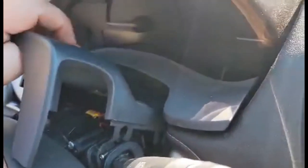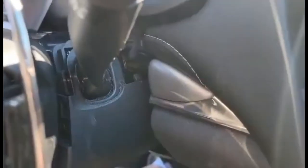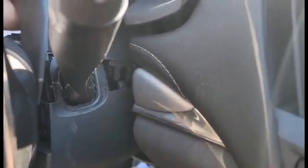To get to those bottom two bolts, you've got to take this off. There will be fabric back here that's in the way, so you pry up on this. You'll feel it pop up and then here's the connectors. You'll feel like you're going to break something but you're not. I use some pry tools, pull up on this, and there's your bottom bolts you can access. With the top two out, get those two out and then we can remove the cluster.